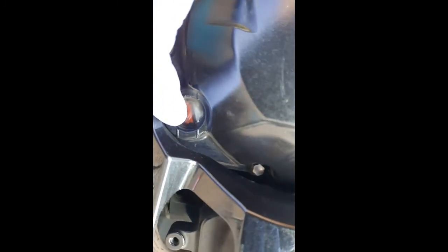If you put it a little bit on the lower side, when you fire the engine up for the first time, it's going to fill the oil filter as well, so you're going to lose a little bit of height on that. So if you have it there, just fire up, let it run for a minute or two, let it settle, and then take another reading.